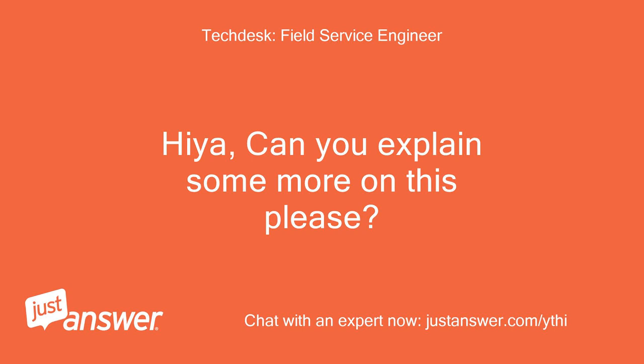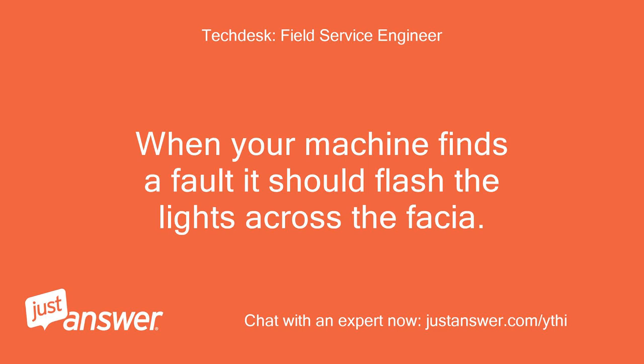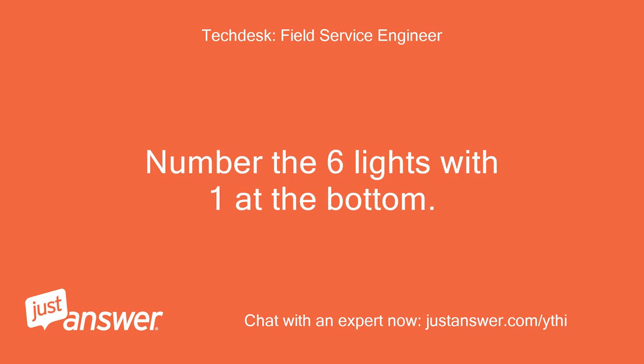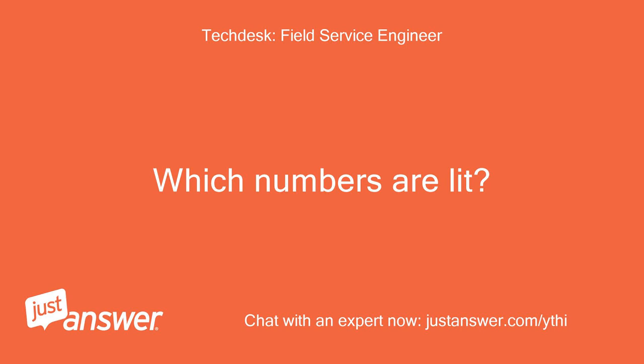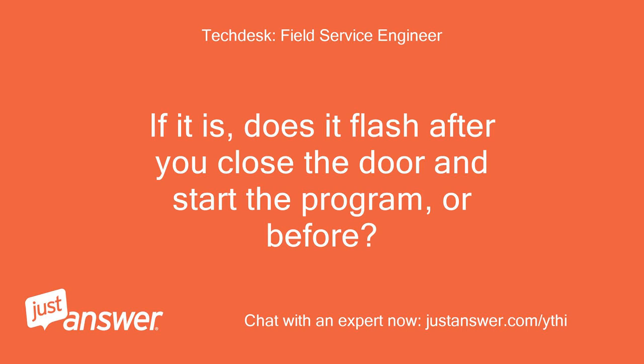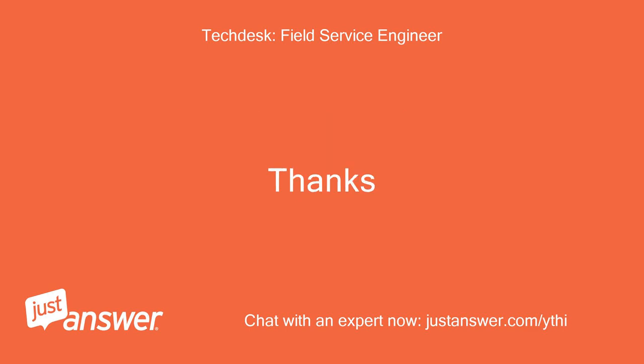Hiya, can you explain some more on this please? When your machine finds a fault, it should flash the lights across the fascia. On the right side, there's a column of 6 lights. Number the 6 lights with 1 at the bottom. Which numbers are lit? Or, is it the door lock light that keeps flashing? If it is, does it flash after you close the door and start the program, or before? Thanks.